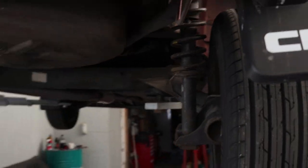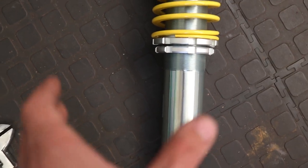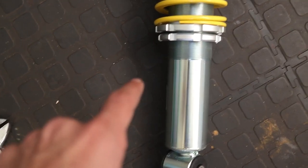This side still needs to be removed. I've got the rear adjusted on this side but I might go higher - I don't want the rear too high or too low. We got both of the rears adjusted to the same height. Now I'm just going to transfer the rubber bush from the old spring onto the coilovers and then we can start installing the rear.